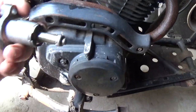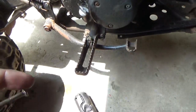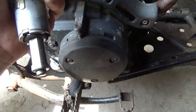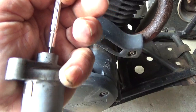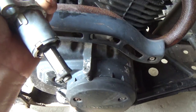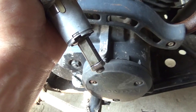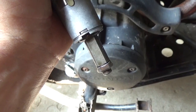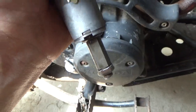By the way, to put it back together again — as you're taking this out, the spring comes out all the way. If you put the screwdriver in there and turn it, it retracts the spring. Then you kind of snug it up and release it, and that allows the spring to go back to full length and put tension back on your chain.